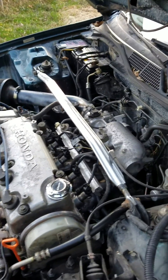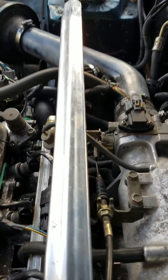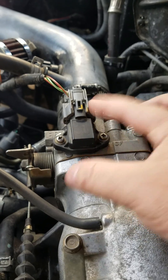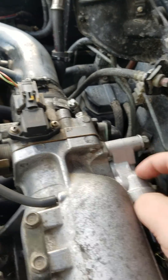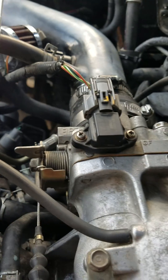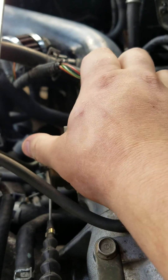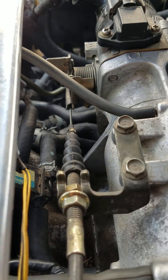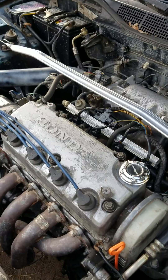A little bit raspy on the throttle because I have my throttle tuned all the way back there. This is your throttle right here, this is your mass air, you got your idle air which I just replaced. My throttle cable — I notice it's been a little bit too raspy, so I need to adjust this piece, at least one screw back and the screw a little bit forward to make sure it's running right. But I'm having an issue with keeping it in idle, and I do have a theory.